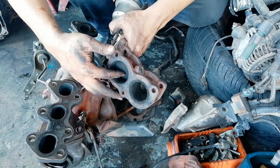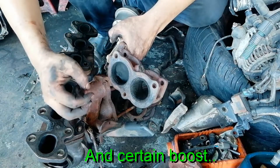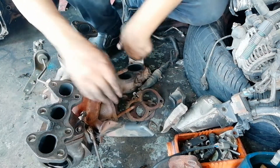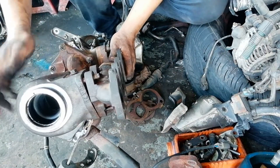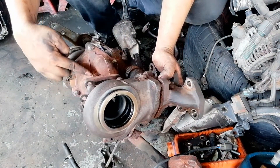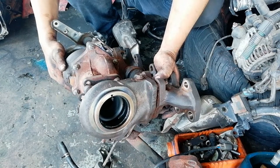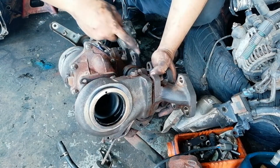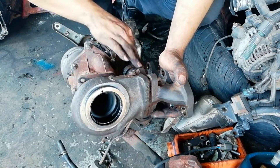From this I can immediately tell that this is your primary turbo. When it reaches a certain RPM, it will open up and allow the secondary turbo to run. So the primary turbo — I can trace back the air and the exhaust flow through reverse engineering. If you can see from here, this one connects to here. So this is our primary turbo — the rear one. You can see there is a six-cylinder here.